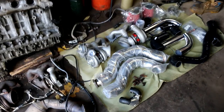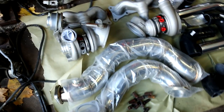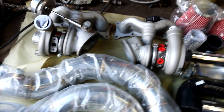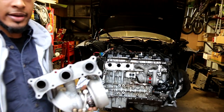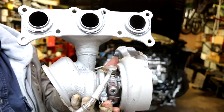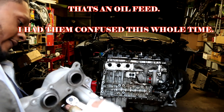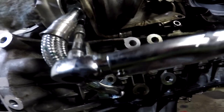Get ready to start installing some of these — the good stuff. So over here you guys can see the stock turbos in all their glory, and over here we have the Stage 3 MMP turbos. They're slightly larger, they have billet compressor wheels, and I opted for the special coating on the bearings. I actually had to disassemble some of it. Right now I have the rear turbo in my hand and I'm going to install this cooling pipe. I'm going to sneak the heat shield back there, so I'm going to tighten this line first before I install it. This one under here is a real pain in the ass.